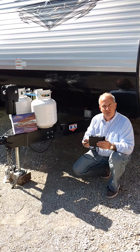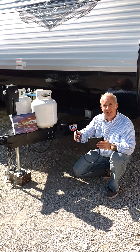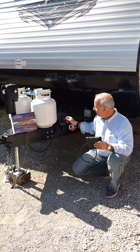You'll feel that tug, so you'll know it's working. This also comes in handy in a trailer sway situation. So you're going down the road, you're starting to get some trailer sway — it's a windy day. You'll hit this key fob, and it'll apply the trailer brakes without applying the vehicle brakes. So that's another option that's there.